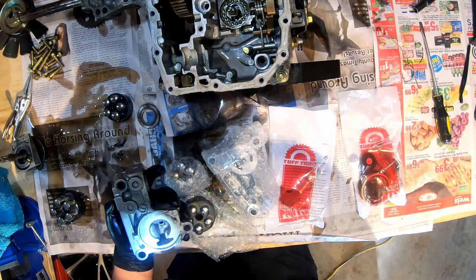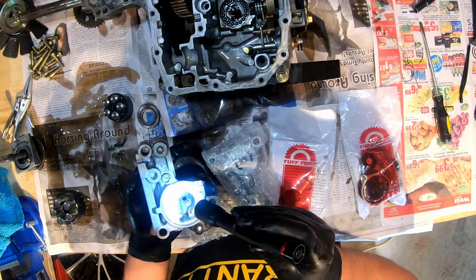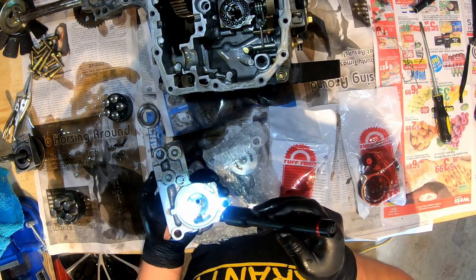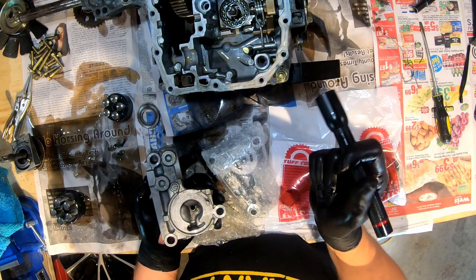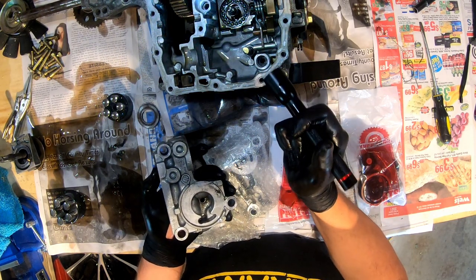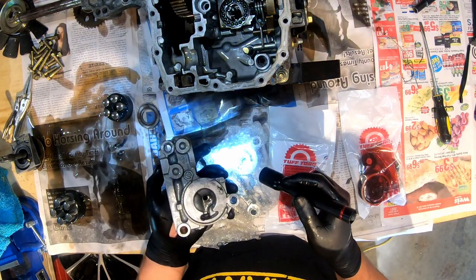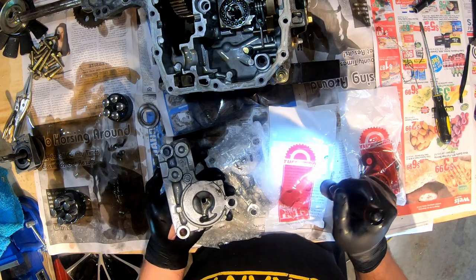When I did my E36 front end upgrade, everything that I took off, some of the things were slightly worn. The boots were torn on the ball joints, and they moved freely, but when you grabbed it and tried to move the ball itself in its socket, it didn't have any real noticeable play. But when I replaced everything all together, it tightened up the steering. It made the steering a little bit sharper.